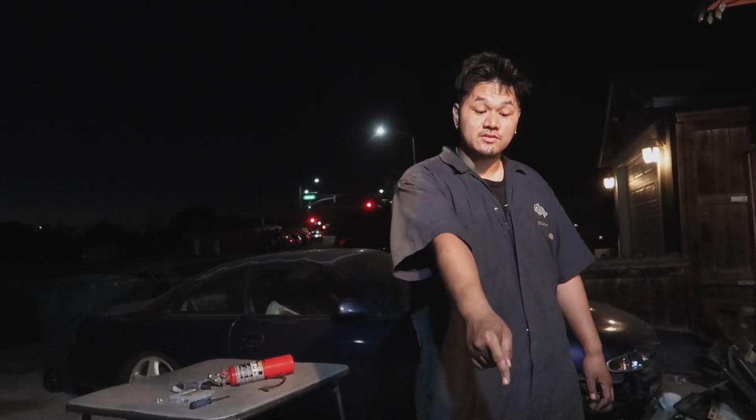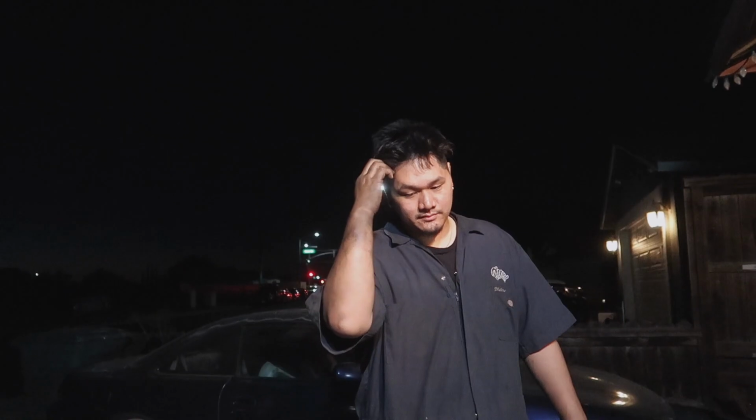So I'm wondering if that's the starter 12 volt wire. I think that is, and maybe it got frayed somehow. I don't know how. Maybe a rat went in there and chewed it up before we had it. You know, because that's a big cavity, like a mouse or something could go in there. Animals like to go into abandoned cars or cars that sit. Maybe a rodent chewed up the insulation, because they like to eat the insulation or something. All I know is that that wire is not supposed to be open like that, and it is.